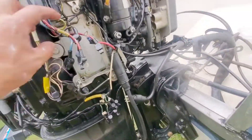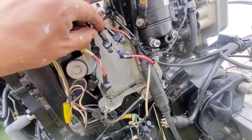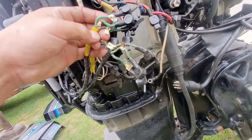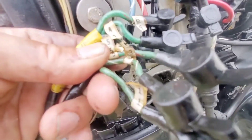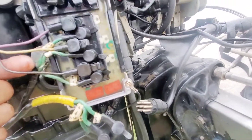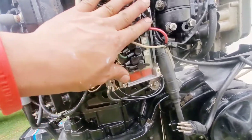Alright, so both of the switch boxes are out. There's a hot mess back here. You just want to make sure that you keep solid wires on the inside box and the stripe wires on the outside. I took pictures of these because these aren't like V6s where they're actually color coded — these are actually numbered. So now the first switch box is hooked up. You got the black sleeve and the black wires, one, three, and five in sequential order going up, and all the color codes match. Now for the second one — everything's in, everything lines up. We got two, four, six. We got the yellow, white, brown. Brand new switch boxes.